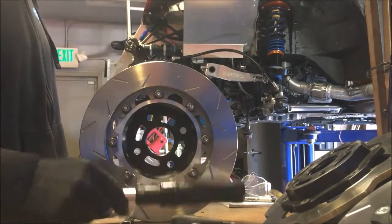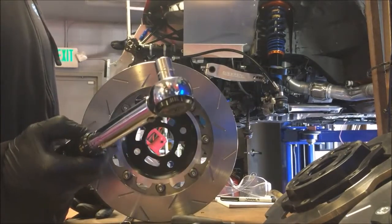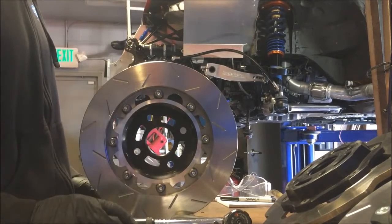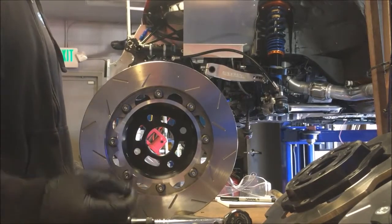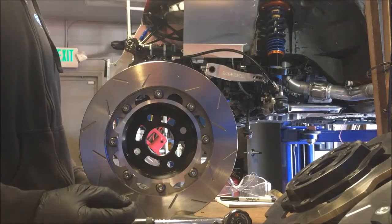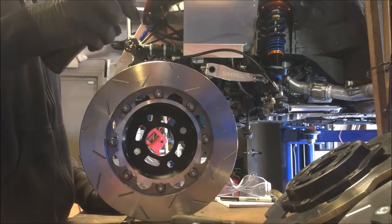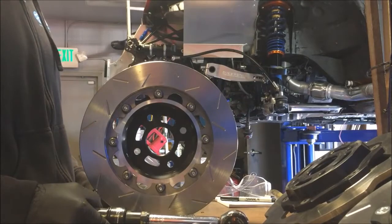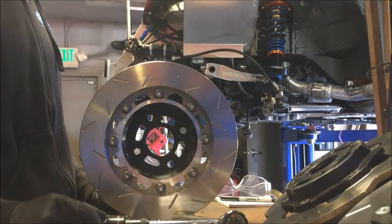The first setting is 18 foot-pounds, and we're using an inch-pound wrench because it's a little bit easier. Most foot-pound torque wrenches go down to maybe 15 or 10 foot-pounds, but if you're down in the bottom end of the range, it's really hard to hear or feel the click. That click becomes more discernible as you go up in torque. This inch-pound wrench goes up to 250 inch-pounds, and 216 inch-pounds is 18 foot-pounds, so that's actually way higher in the range and I can feel the clicks really easily. When I'm doing 25 foot-pounds, I'll switch to the longer foot-pound wrench.